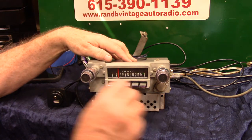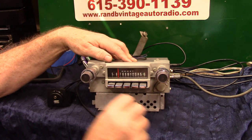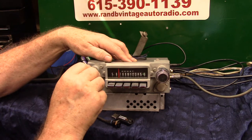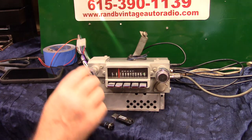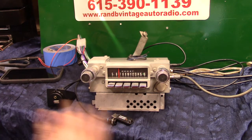Which is cool in case you're looking for something. Now this radio will scan for you. Let's put it in scanning mode — you can tap this four quick times, or turn the volume up and back twice. Scanning for stations. Now it's going to scan. I'm going to show you how to keep up with what you're doing. We're going to find a station and lock in on it in case you want to preset a preset. At any time you don't know where you're at, FM 90.3 — now we're going up the scale.